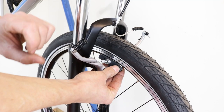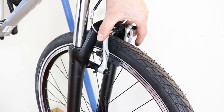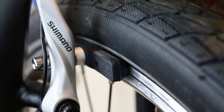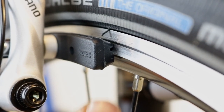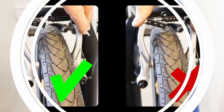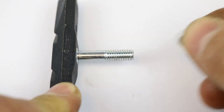Fit the new pad with the correct orientation. Push both brake arms against the rim and hold in position just tightly enough so that you can still adjust the pad with one hand. Position the pad so that it sits squarely on the rim, with about half a millimetre of rim showing at the top. Too high and it may rub on the tyre causing premature wear; too low and not all of the pad will touch the braking surface, wearing unevenly and causing the brake to catch on the underside of the rim. The dipped and domed washers will settle into place, allowing the pad to push evenly on the rim. While still pushing the brake against the rim, look at the brake arm — the aim is to have it as vertical as possible. The position can sometimes be improved by swapping the concave washers.